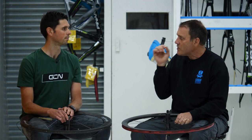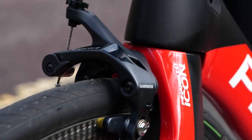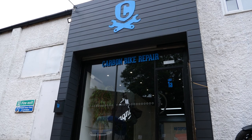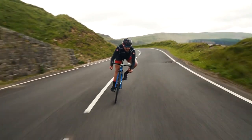If you start to feel a flat spot with a tweaking or whistling sound at a point, the best thing is to stop. Let the wheel cool down — you'll easily get to the base of the descent. Then take your bike straight to a carbon repairer. If you save the brake track by not wearing through the brake surface at that swelling point, it can easily be rectified. That's really helpful to know.